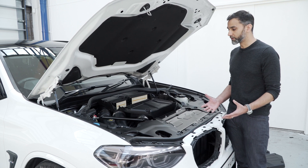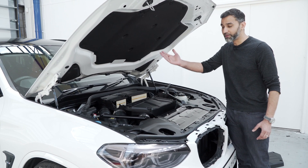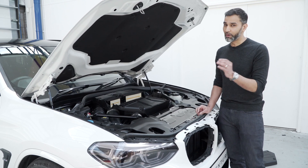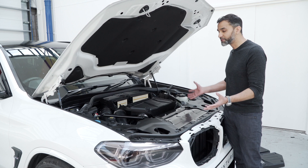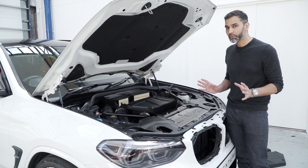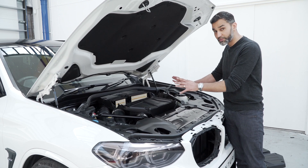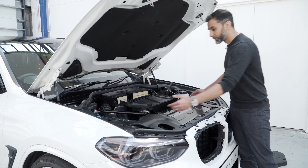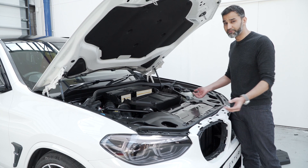What we thought we'd do was try to increase the volume, but on analysis the distance between the top of the airbox lid and the underside of the bonnet is very small — maybe five millimetres at most, so changing that wouldn't have made much difference. That would also have upset the flow path unless we changed the base completely. The trade-off between a completely new design and what we'd gain in efficiency was so small that we decided to change the filters to higher-flow units with less resistance, leave the airbox as is because it's a good design, and provide the system with big scoops at the front to force air in — making the two feeds less restrictive.